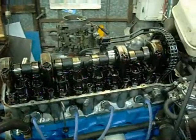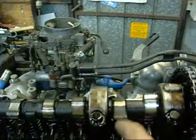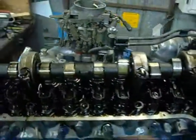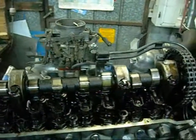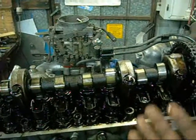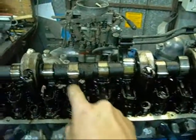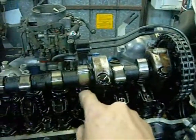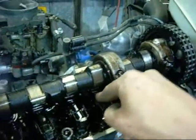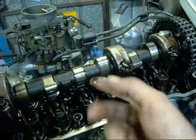It's pretty much been teaching me how to set up car engines, how the valve lash on these things work. Particularly tonight it just told me that they wear in, not out. They don't become sloppy and noisy, they become very tight, as the valve margin wears out, like the valve wears into the head. These tappets lose clearance. Even though this one here is 180 degrees off firing point, it doesn't even move — it's that tight that it's worn its way up and it's sitting on the cam already.